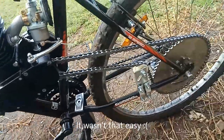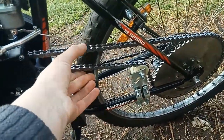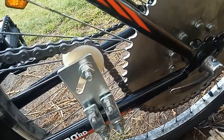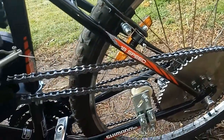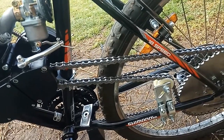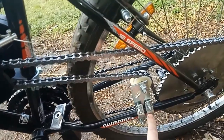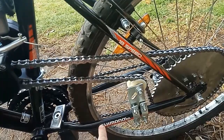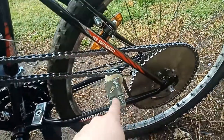After running out of daylight yesterday, I got a good tension on there. However, there's no room in that tension for when the chain inevitably stretches, so I'm going to have to go ahead and remove — I'm thinking at least two links. I need to be able to move this further back towards the rim because the chain keeps on binding up.